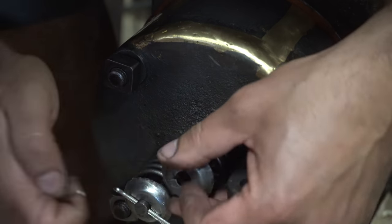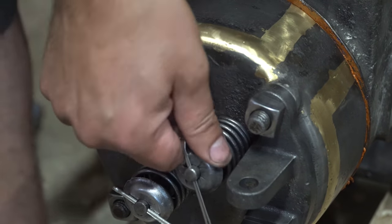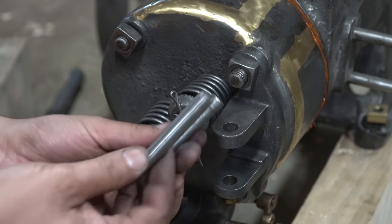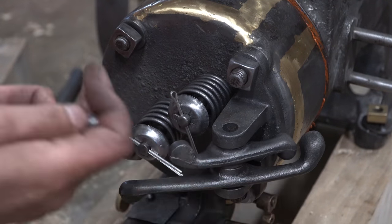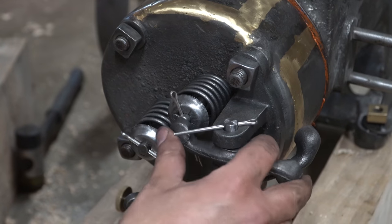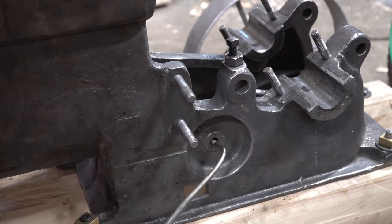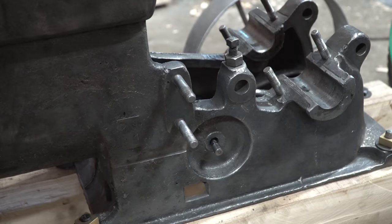The valve springs I can actually just put on by hand, which is odd — they're weak enough that that's the case, but they don't need to be any stronger apparently. The rocker arm pin was completely worn out so I just turned a quick new one — nothing very confusing or special about that. I'm loosely putting in the cotter pins that I will cut off and bend out when I'm sure everything is correct. The rocker arms are fine enough — you have to remember that everything on this motor is kind of made to be sloppy.